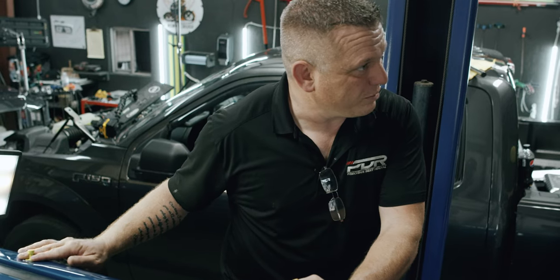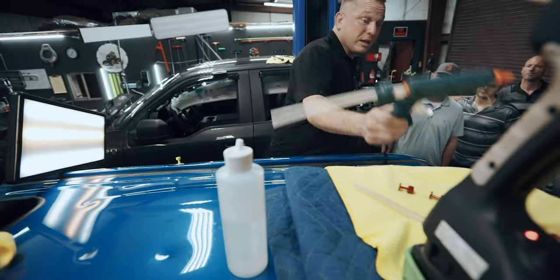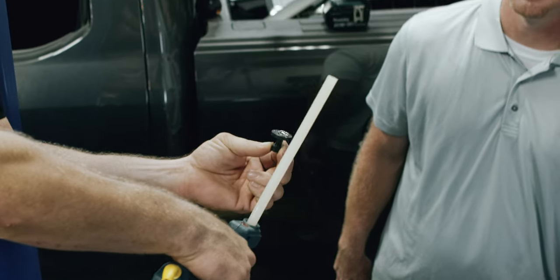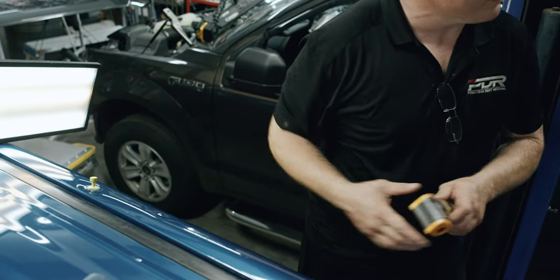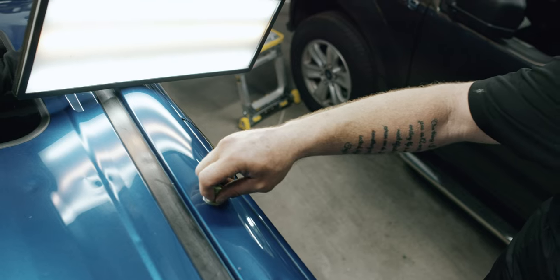What you need to go for there is the look of it. It's perfectly clear when it's coming out. Look how thin this is. We'll just put it on this one. It's clear, right? What color is it going to turn into? It's more of a white, cloudiness. That's almost like its indicator, almost like a color temperature change, if you will. So as it starts to turn milky again, you know you're getting there.